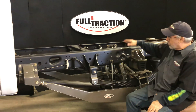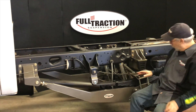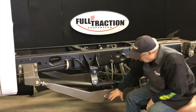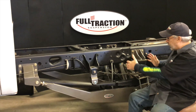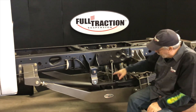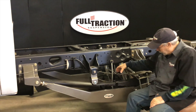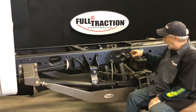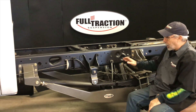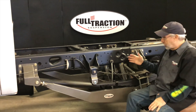For the purposes of this video, we've removed the bed on our 2004 F-350 crew cab four-wheel drive to show you exactly what we're dealing with. What we've got here is the addition of a functional trailing arm — not one where we're fighting the geometry of the leaf spring and the arc of the radius as it swings through its suspension movement. This is now controlling everything. The leaf spring is just acting as a spring now and the suspension is free to move more freely and operate without any binding or pinion angle change at all.